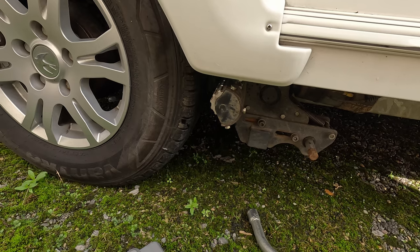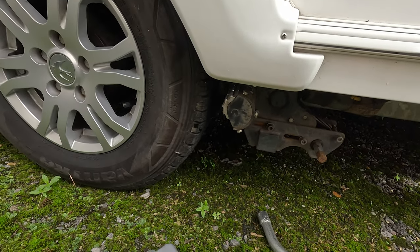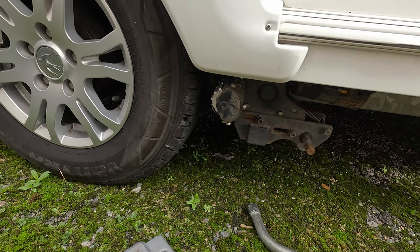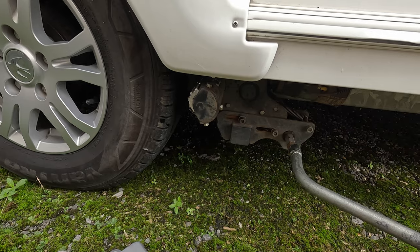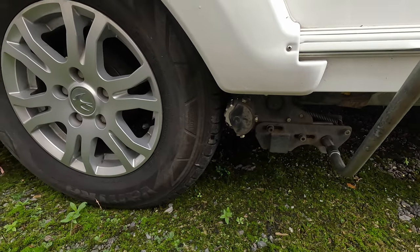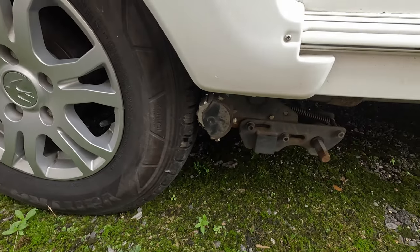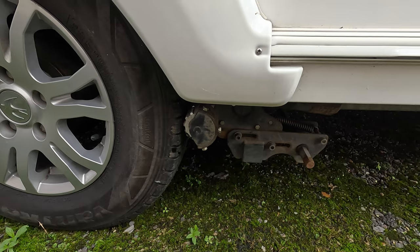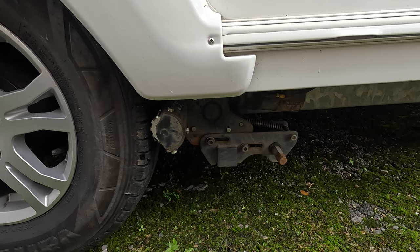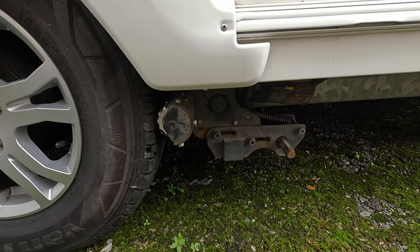Righty-o, so that is the two end caps replaced either side, and spinning okay there. So let's engage the motor mover and see if the problem has transferred, which is hopefully yes. If it's still clicking, obviously it's a bit more drastic, and I'm going to have to go back to the drawing board and actually have a look at the motor mover itself and see how I take off one side. But let's try and move it and see if we still got the click.